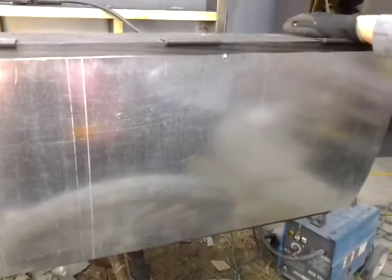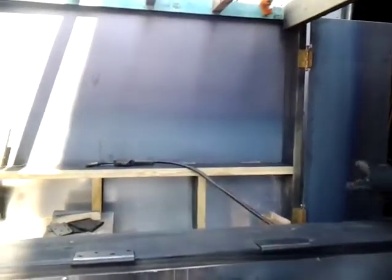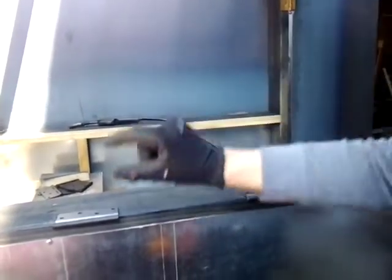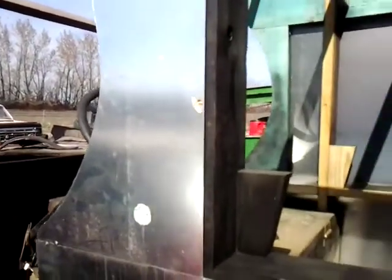It'll just barely miss the fender - that's the whole idea. We have to weld it in first, so we have to mount the fenders before we even make the cut, so that we can measure how far that will be. But I'm going to have to paint the fenders first. So we'll get this bottom welded on both sides, and then afterwards we'll cut this, and we'll mount the top and trim it. The reason is because we want to get that gap when it does the curve - it's a pretty tight curve in a couple spots, and we were able to do that just with the die grinder going around this curve here.